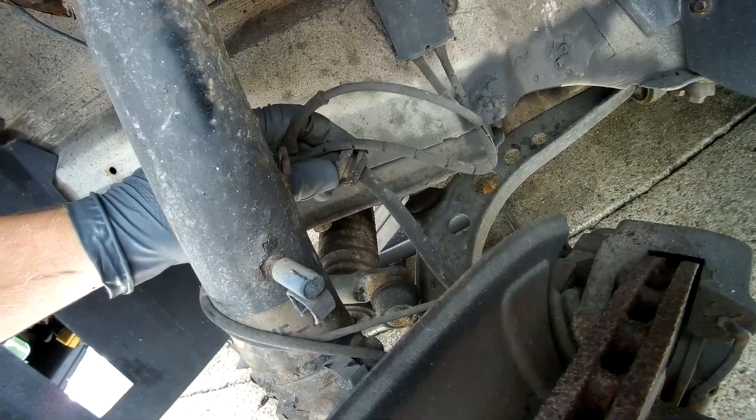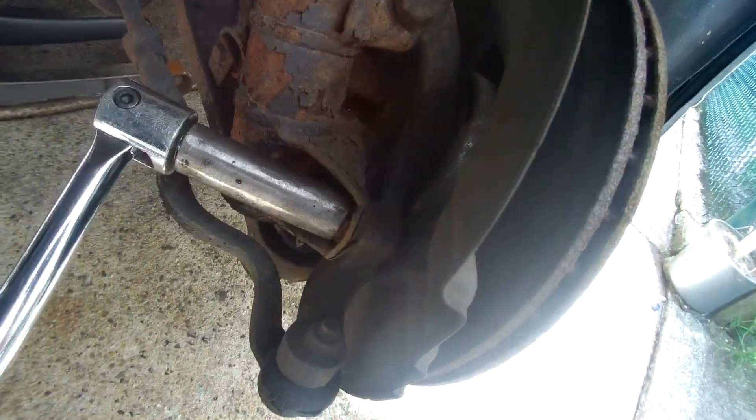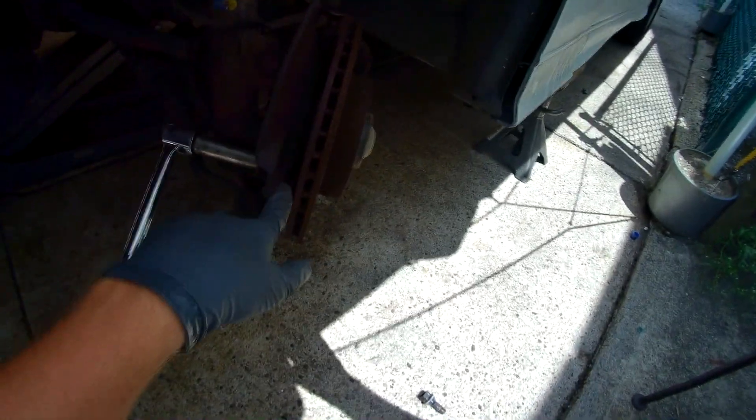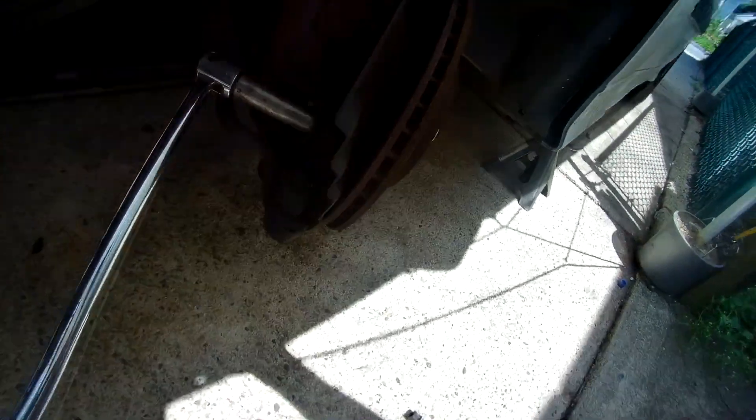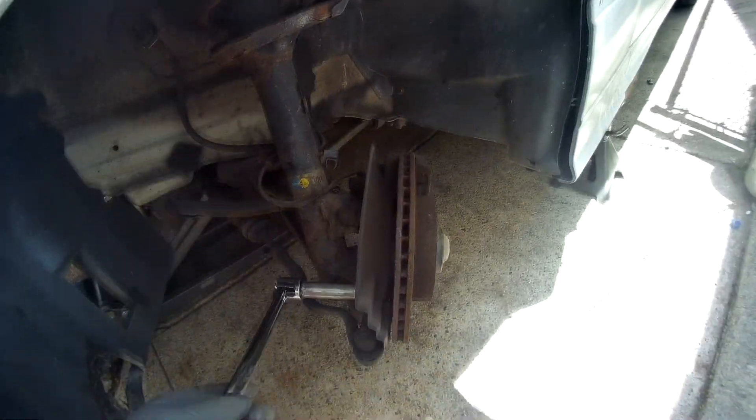There's this third bolt right here that's held on with a nut at the other side. So there's one, two back there, and three here to get the bottom piece of the shock off. I already loosened up these lines, took the brake line off and the sensors off. So I just got to loosen up this bolt — it's an 18mm socket. Put it on the bolt, have my Harbor Freight breaker bar. I turned the wheel so I have good access to the bolt. When I do the other one, I'm going to turn the wheel the other way so I can put the breaker bar going that way. Give it a little tug — it loosens right up.